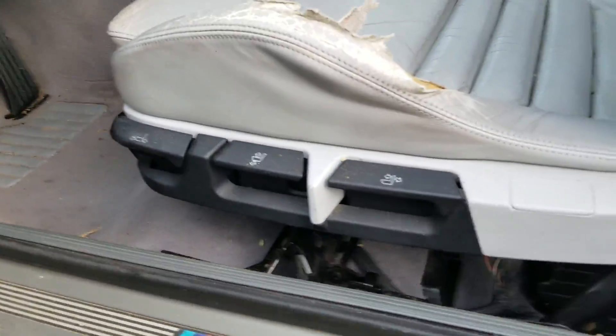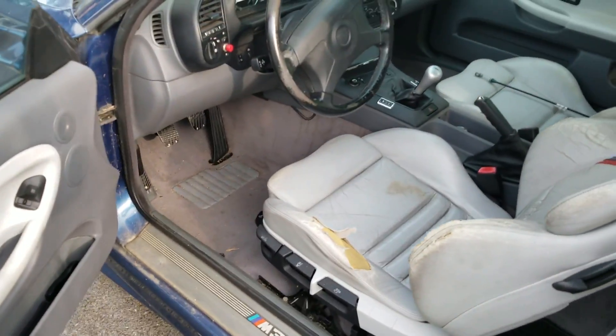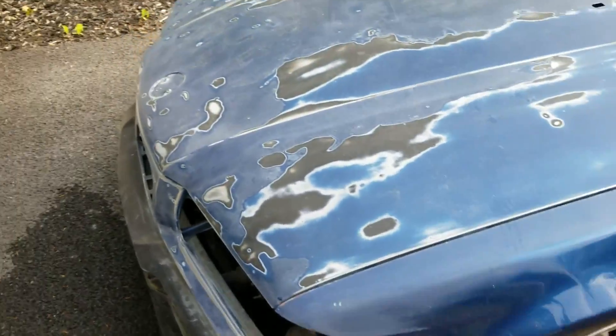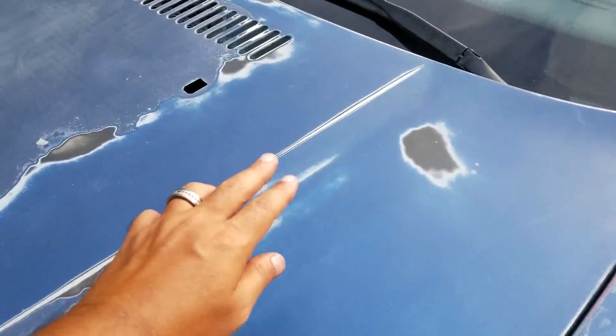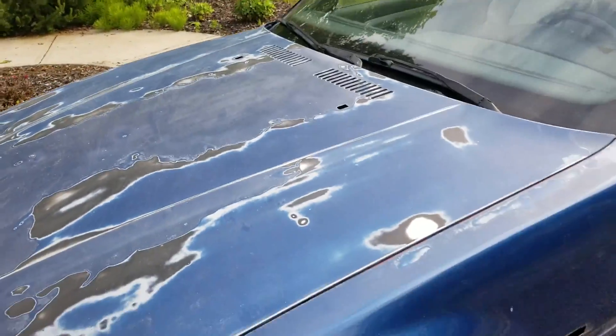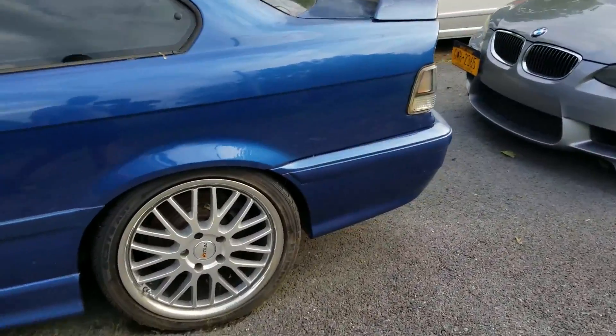I also need to replace the seat because it's stuck all the way up — my friend broke it. I have a new one. But the main reason the car is sitting here is a major gas leak. The gas lines have dry rotted. The leak is somewhere around the gas tank area because you can see it leaking from underneath. That's what I plan on working on right now, though I probably won't film it — I just want to concentrate on getting it done. It's freaking hot outside.